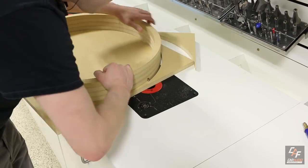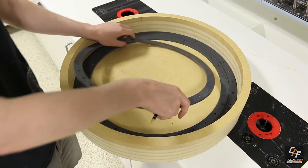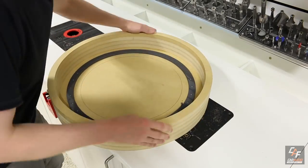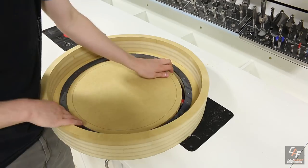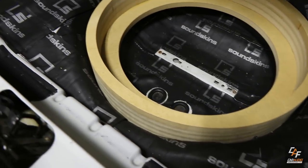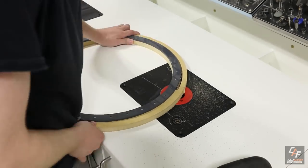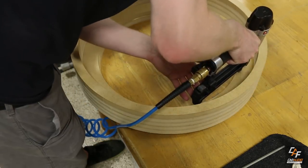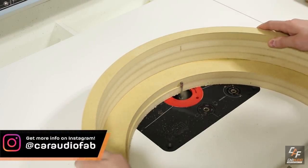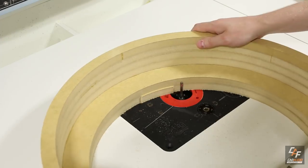To make my transition layer I start with trimming the same outside profile but leave the inside intact. I add some of the Mobile Solutions circle templates inside my shape and sketch a few lines to know where to drill my pilot hole to start the router bit. I then stick one of the templates in place using template tape and cut the inside of that profile. After a quick check in the vehicle I slightly increased the size of the hole in the transition layer to allow for clearance on the subwoofer magnets, then flush trimmed the inside of the new ring to match the transition layer.